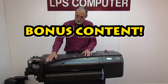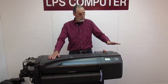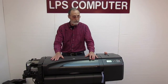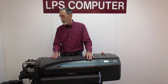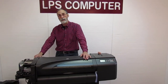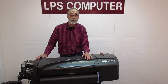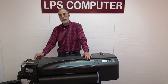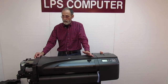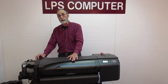There seems to be a little confusion out there that where people think because there's one part number in the service manual, there's only one kind of emod. And in one respect, that is true. They're all the same part except for the 510, which is physically different. They look the same, it mounts the same, but electronically it's a little different. For the 500s and 800s, they are in fact configured differently. They're programmed differently, even though they're the same part.